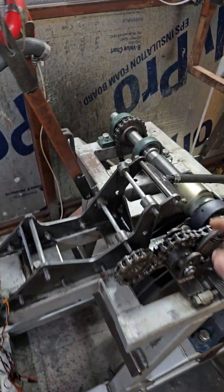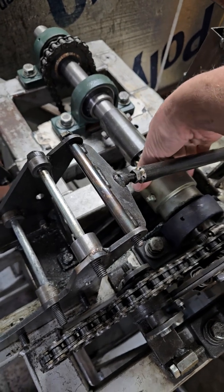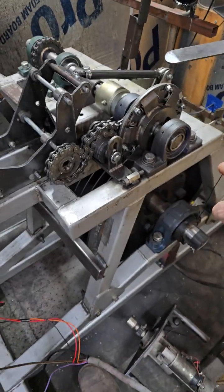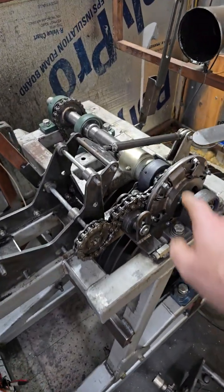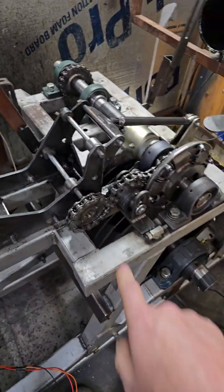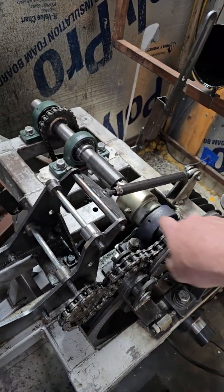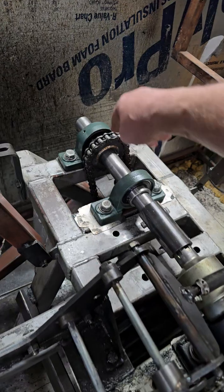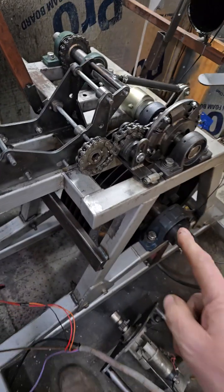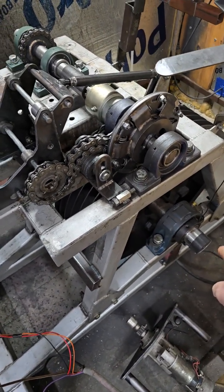So you're going to need to put in, this is a PTO overdrive clutch or override clutch. And what it does is it allows the motor to turn the dyno, but does not allow the dyno to turn the motor. Basically, this will ratchet, okay? So it gets driven, and I'll explain this here in a second. It gets driven back here, goes through the PTO override clutch, and then to the sprocket back here, and the chain that goes down to the main shaft. And then I pick up my main shaft RPM down there.